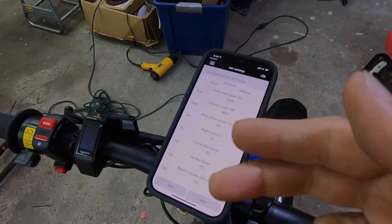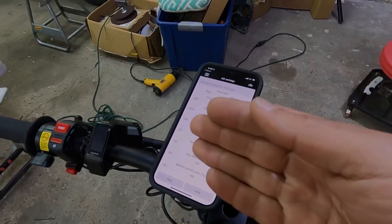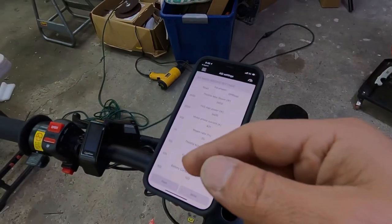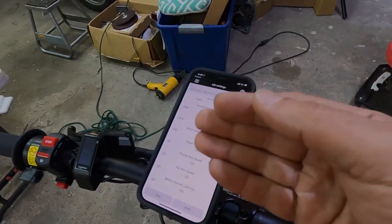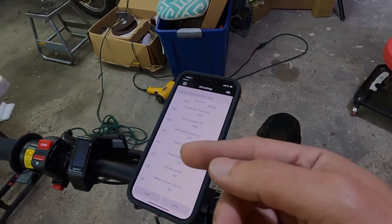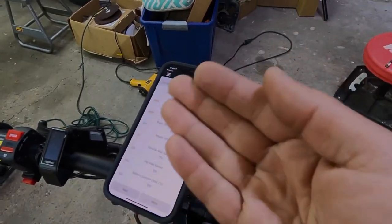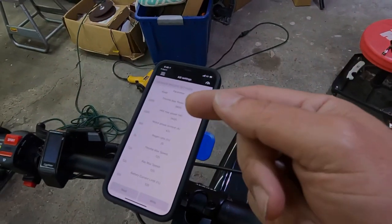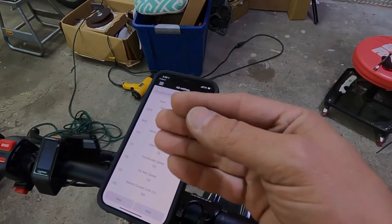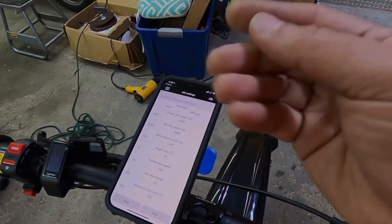So let's say you went from a 60 volt battery to a 72 volt battery, and obviously you increased your power settings and you flashed the parameters with the CYC app for the 72 volt battery. If you're gonna go back down to a 60 volt, because let's say you fully depleted the 72, you wanna go riding again, you're gonna have to remember, go back to the CYC app, flash the 60 volt parameter, and then go into the